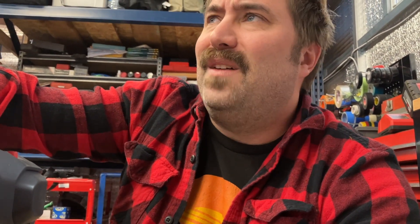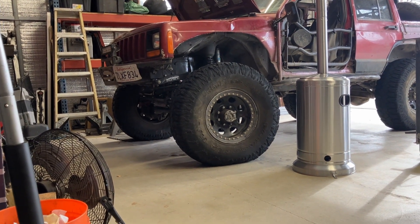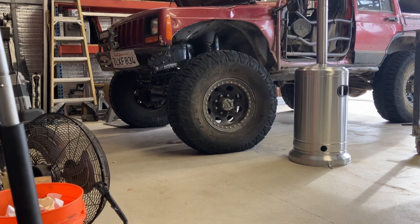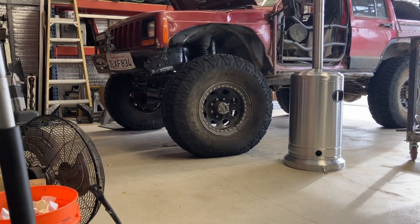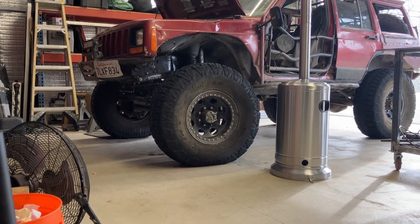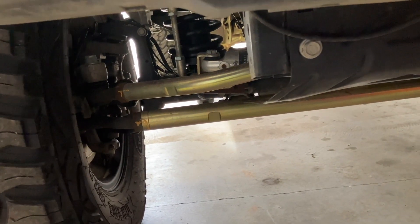They say Torx bolts are like 125 or 135 foot-pounds, which is kind of a lot. On my XJ, if the track bar bolts come loose or the jam nuts come loose after a run, I will get death wobble sometimes on the freeway. The stabilizer usually will mask it, but I can still get death wobble fighting through that stabilizer. Maybe once every six years a jam nut comes loose. Whereas this thing, it's like every run jam nuts - all the jam nuts like to come loose. I started paint marking them finally.